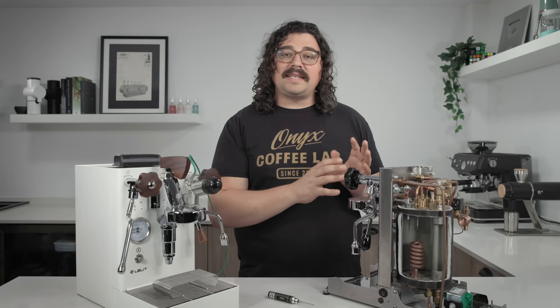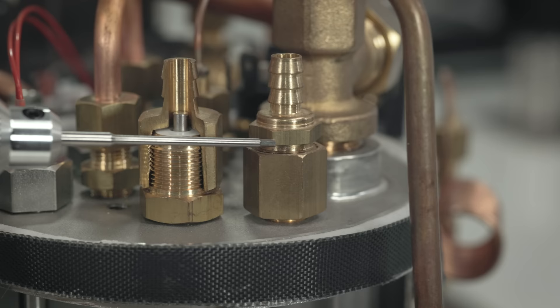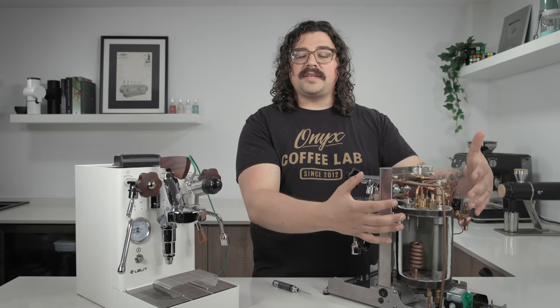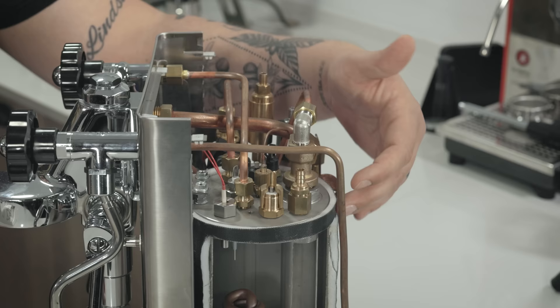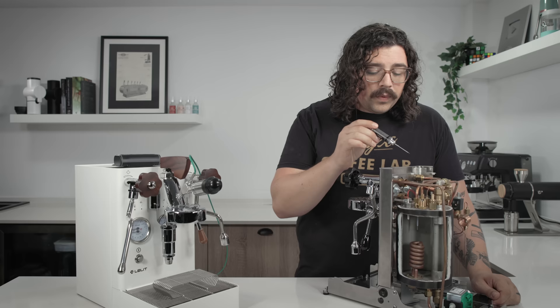There is a brain in the machine — it takes into account the temperatures it's reading in order to maintain a consistent temperature at the group head, as consistent as possible with a massive chunk of chrome-plated brass. Also interesting is the release valve and vacuum valve. Normally this valve has a release pressure of around 2.5 bar, but on this one it's rated at 5.6 bar — really nice to have something that robust. We also have the anti-vac valve right there.